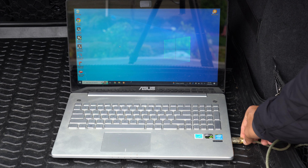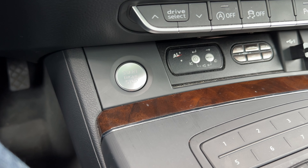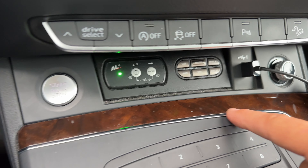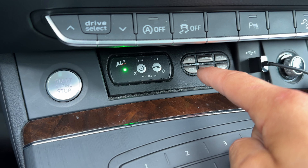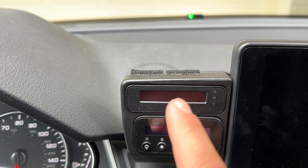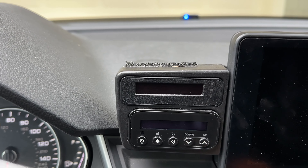So we'll go ahead and start unplugging things and shutting things down, then plug the detector into the computer over USB. Next, you'll want to go ahead and turn on your car. Two quick tips here. Number one, the Redline is not going to power on when you've got it plugged in via USB, and the display is not going to power on either — that is normal. Second, I've noticed it's better to go ahead and turn on the car's engine as well, not just the accessories and run the Redline off the battery. Running it off the battery can sometimes throw low voltage errors on the Redline and it'll shut itself down. So turning on the car's engine will help you avoid that issue.